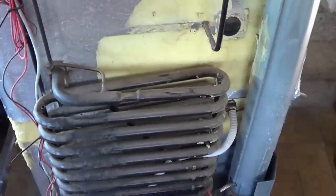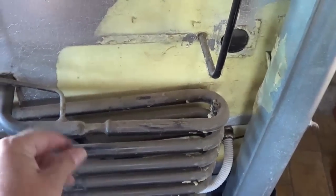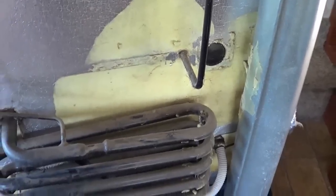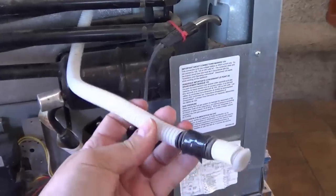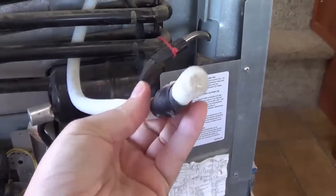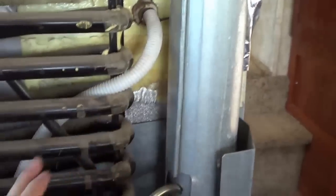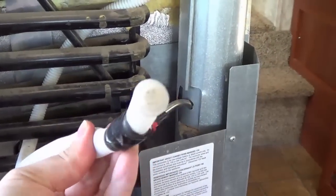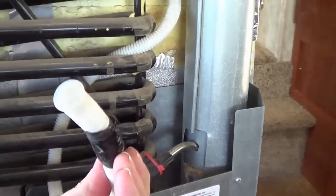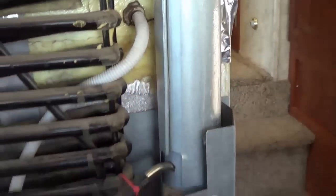While I have it out here I'm also going to clean out all the dust that's started to collect — I'll vacuum and brush that all off. And I've been wanting to change this drain hose; the water that melts inside the fridge comes out through this tube, but the plastic is getting really brittle and starting to crack. So I've picked up a different hose and I'm going to change that out while I have everything apart. Let's get to work and get the new fan in.